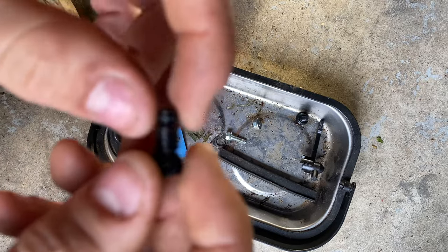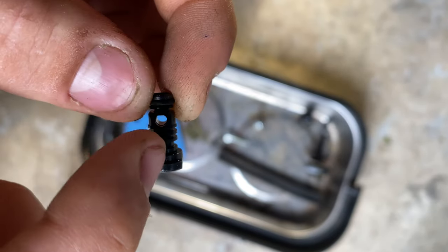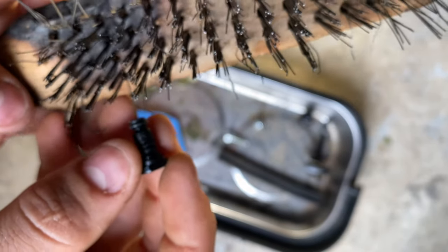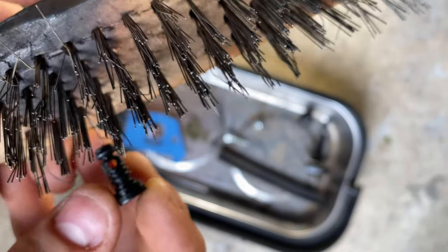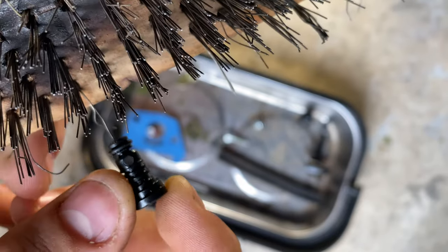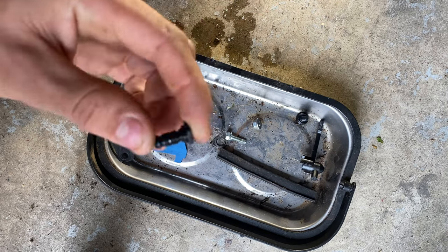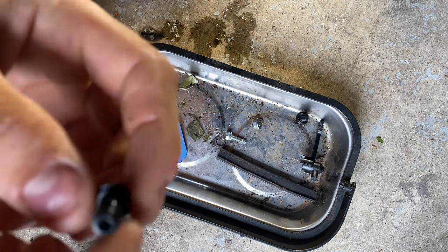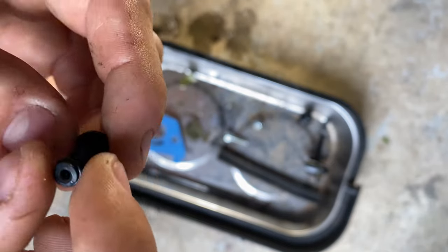Next is going to be the idle jet. There are rubber seals on here so be careful. The way this one works is there's a little hole right here and it sprays out these bigger holes. This is where the wire brush comes in real handy because these holes are very, very small. You're going to want to push that through — you might have to push a little hard to get it to break through, but you should be able to see the wire inside. Then just give that a good blowout with the carburetor cleaner. If you have a light, shine it in through the side — you should be able to see through there to verify. That's all you need for that one, and with all the jets clean, let's move on to the main carburetor.